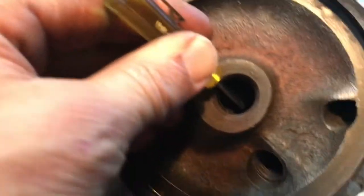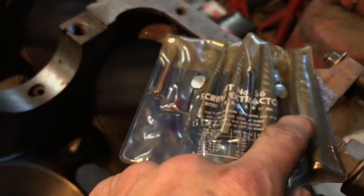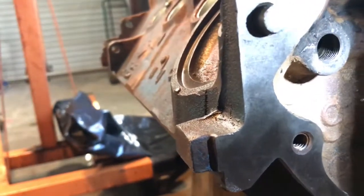...was when drilling this passage out to get it to half inch — I could not get this plug out. The guys that machined the block put some kind of sealer or Loctite on there. I ended up drilling the plug, tried to use some easy-outs after drilling through it, but there wasn't enough meat left around the edges. So I just took a chisel and chiseled that plug out until I could finally pop it out.